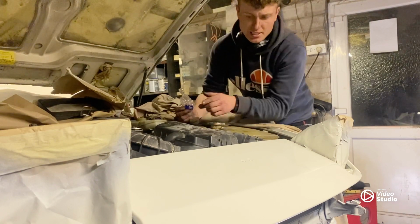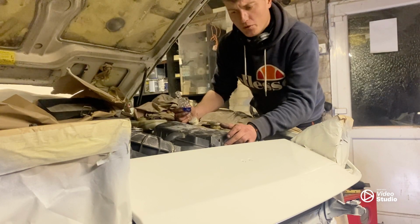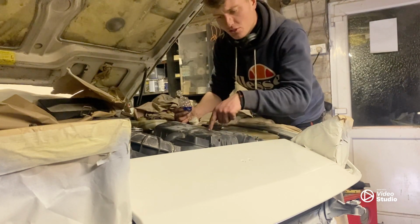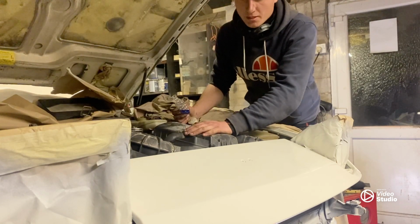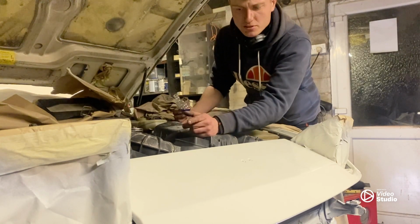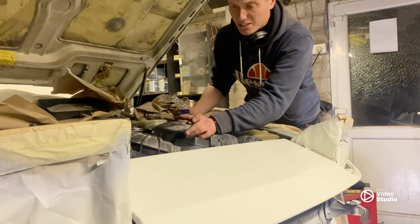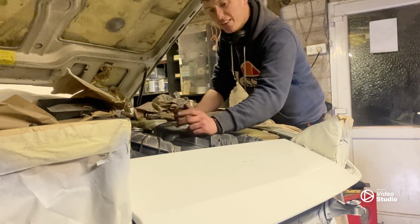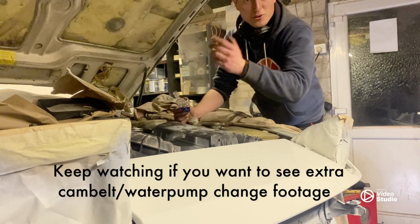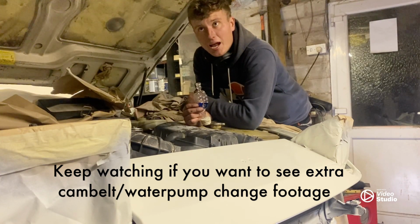I need to test the alternator to make sure that works, because that wasn't working. Off camera we've put a new voltage regulator on that, and hopefully that'll work. If not, we're going to need a new alternator. I've also, about 3 months ago, rebuilt the power steering pump, so that's going to need to go back on, be retested, make sure there's no leaks, make sure it's working. And then other than that, you just need to polish up, and then it's ready to go in for MOT. Anyway, thanks so much for watching, and we'll see you next time.